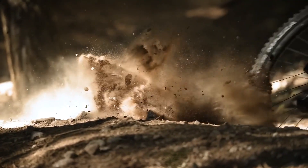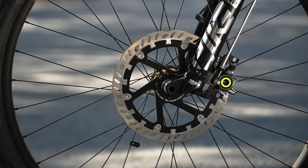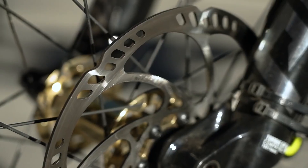Also check: did you use different materials? Have you got organic and sintered in different places — front and rear — because that grab can kind of feel different as well. Also, maybe if you've definitely got too much power in your back brake and you don't like that, I wonder what disc size you're running. If they're the same, if they're matched, maybe you can downgrade the size of your disc. It'll give you a little less grabby power in the back and feel a little more modulated, a little gentler.